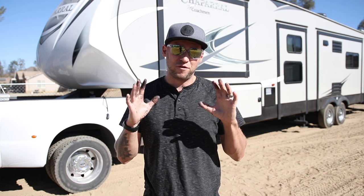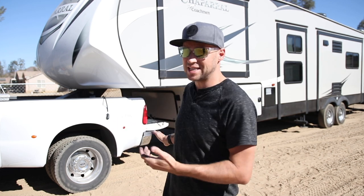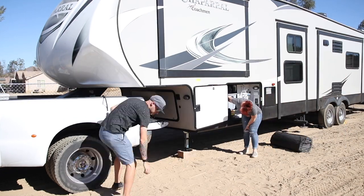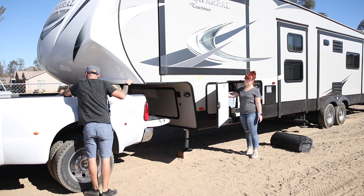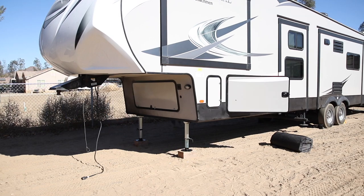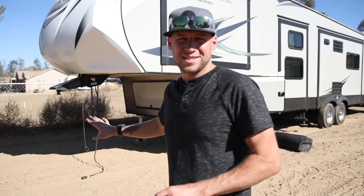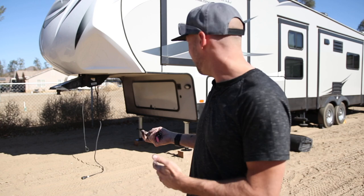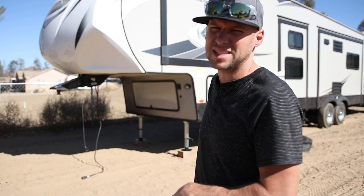The next day we complete the full weight test — making sure the front jacks can actually support the weight of the entire loaded trailer. With the truck warming up, we drop down the front jacks, detach from the truck, confirm it supports the weight, and then raise the unit so it's level. Success: the trailer detached, the jacks are supporting the weight just fine, and the unit came up to level with all weight supported by the front jacks and the axle.